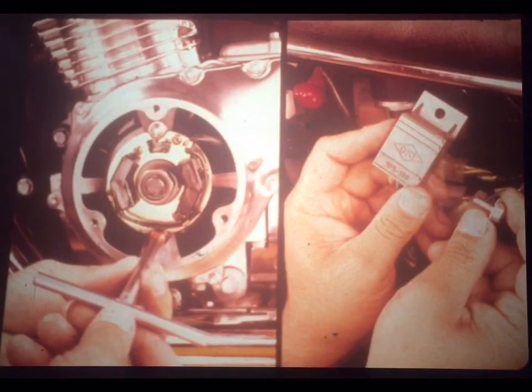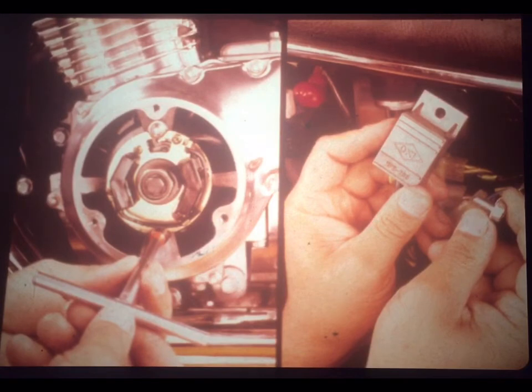And step 8 says, substitute known good parts. Admittedly, this is a final effort, but seldom should it be required. Usually, the tests up to here will locate any problem in the primary circuit. However, some problems come and go, especially those caused by heat and vibration. So this is where you'd get into installing known good parts to fix the ignition.